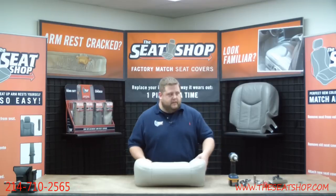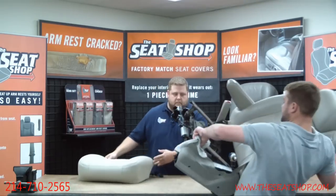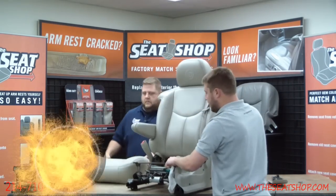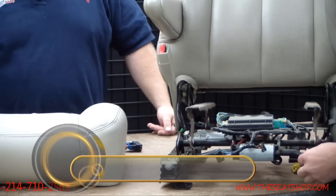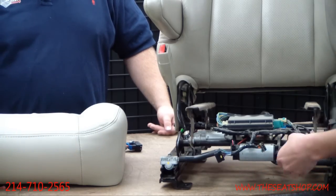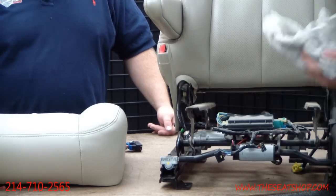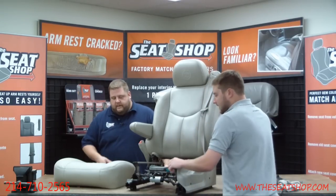Go and throw the seat up here. We'll finish bolting this thing back up. A quick little note when you're carrying the seat, if you're moving it on and off the bench — there's a plastic rail right here in the front that houses all the motors for the power controls. Don't grab a hold of this plastic part. We always grab a hold of this steel part right here. Get a rag so you don't cut yourself — it is sharp. If you pick it up by there, it'll break.